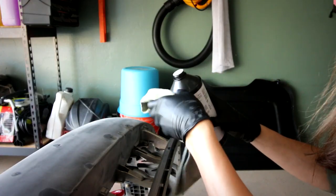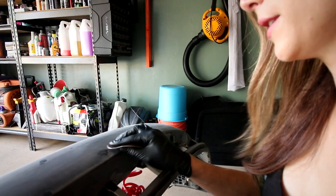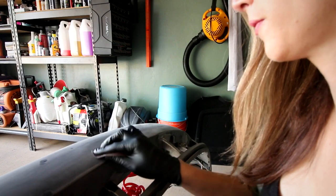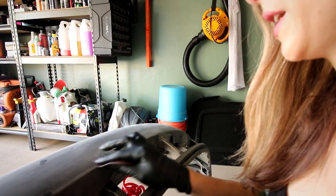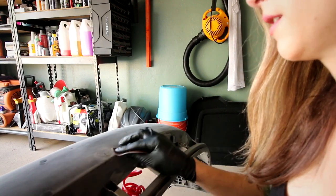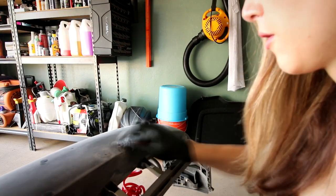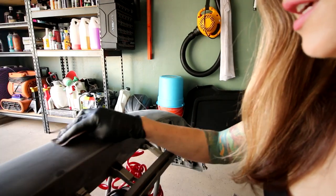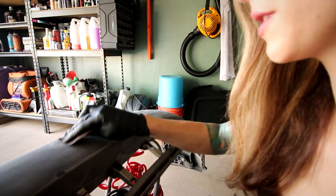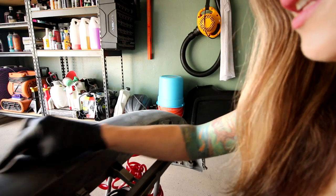Take a little bit of wax and grease remover and get this good and prepped. I'll give it some more 80 grit so I'll have something to bite onto. I'll do a nice big area — I didn't do a big area last time, and that might have been part of the reason why, because I didn't go far enough out maybe. And then this spot a little bit more because there's a couple air bubbles in it, and then that spot a little bit more.